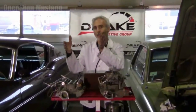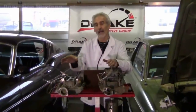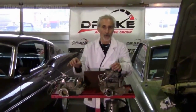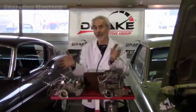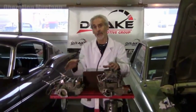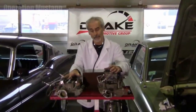You're also putting all the problematic things that new cars have onto an old car — check engine lights, throttle position sensors, all sorts of sensors that can go wrong. You're pressurizing your fuel system, so you've got a whole gas tank situation to deal with and it has to be a sealed system. The plumbing and the electrical is a whole other thing. So if you're paying somebody, you're spending some big bucks to put this system on.